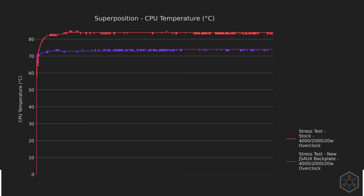Let's see a few new comparisons. CPU temperatures on Horizon Zero Dawn were about 5°C cooler at stock speeds and 7°C cooler while overclocked. GPU temperatures were similar, losing 5°C on average. Performance was much more stable. Cyberpunk 2077 ran 5–6°C cooler on the CPU when overclocked, with similar GPU results, pulling a few more FPS at both stock and overclocked settings, while staying much cooler on the chassis and quieter by about 5 dBA.